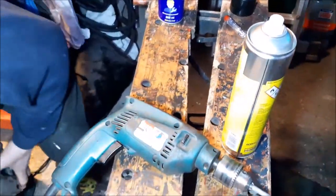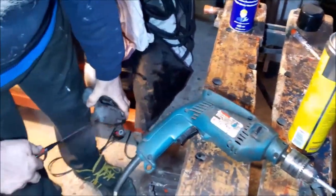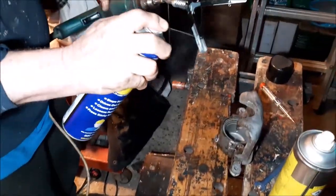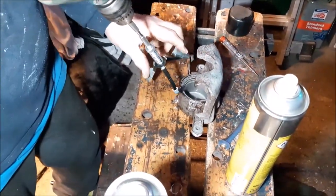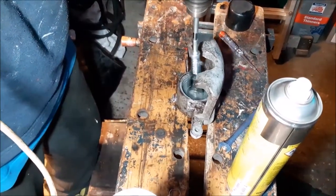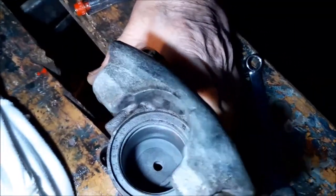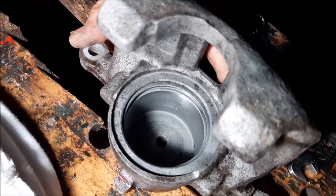We've put a little bit of brake cleaner in to clean out the oil we used whilst we were honing. Now doing the second caliper — same process — a little bit of WD-40 on the tool and a little bit into the caliper as well. Hopefully you can see that surface is looking much better and they're ready for us to start rebuilding the caliper.